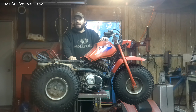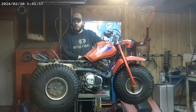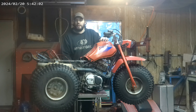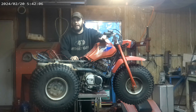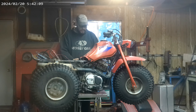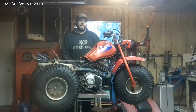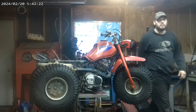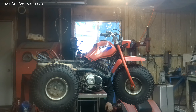At this point, if I was taking a guess, I would say it's probably going to be lean. I know that the throttle itself does close all the way, so it either has an air leak somewhere or the carburetor is not adjusted properly. So I'm going to fire it back up and then spray some flammable stuff around the carburetor to check everywhere — just seeing if there's an air leak. If it changes the idle, that will indicate a leak. Nothing actually seems to affect the idle as I'm spraying it.